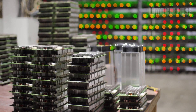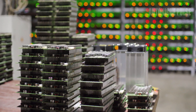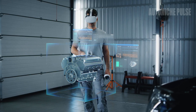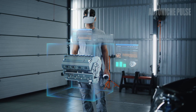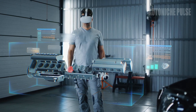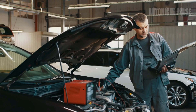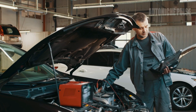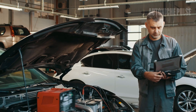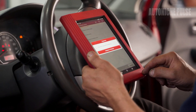The downside here is significant. The ECM is essentially fed a static signal that doesn't change with engine conditions. Over time, this can lead to the ECM not adjusting the fuel mixture correctly, resulting in poor performance, increased emissions, and potentially damaging engine components due to improper combustion. Also, newer vehicles with more advanced diagnostics might not be fooled by this simple trick, detecting the discrepancy between the input and actual engine performance.